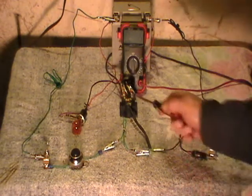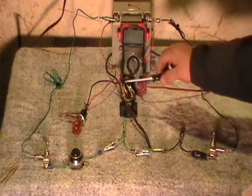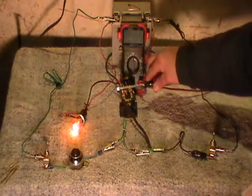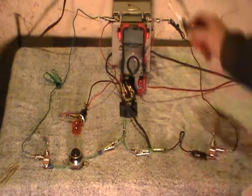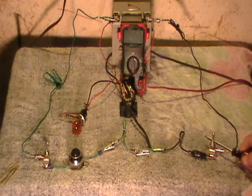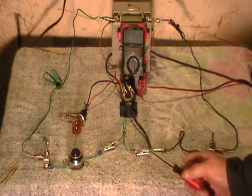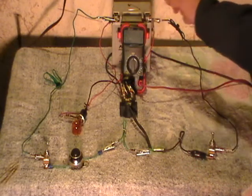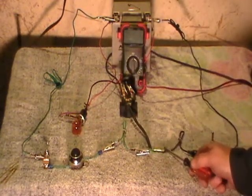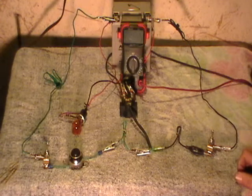From the push button switch it goes to a starter solenoid. The starter solenoid is really just a big fat switch. What's happening internally is it's connecting two posts together, and when those two posts connect, the bike cranks over. The other side is our power side, and that goes through another switch — the key ignition switch. So as we turn on our key, we're allowing power to get to the solenoid. The path is complete — it always starts at the source, ends at the source, follows through some switches, gets to the component, and the power continues back to the source.